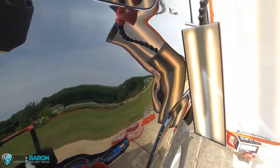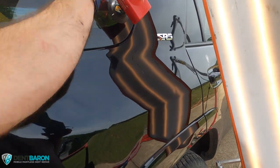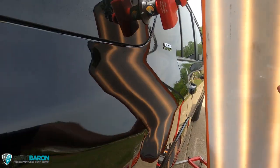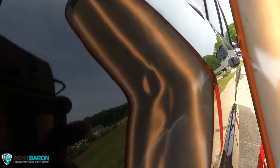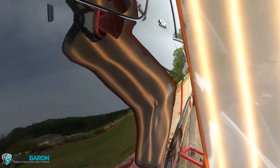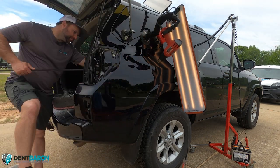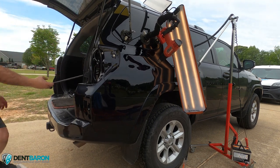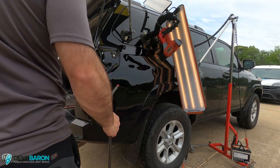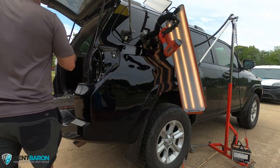It's coming out nicely, not looking too bad — still very clean. The hardest part was where I locked the dent up at the top above the body line. At the angle I was standing when pushing, I couldn't see where I was pushing. Right there close up you can see the bottom of the dent, but when you're really far back you just can't see it — it was a huge challenge. I had to use heat almost the entire time because I did not want to crack this paint.